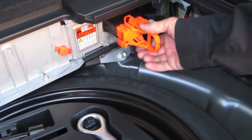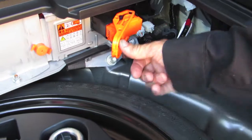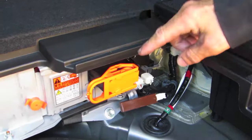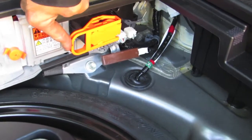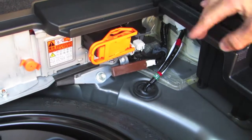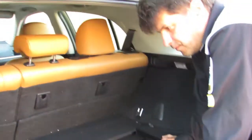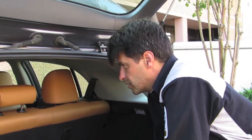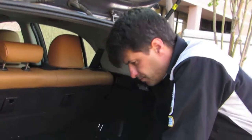Start to rotate it — you see it's going in. Some people make this mistake: they go all the way in and think it's done. No — even after you've pushed it all the way in, you still need to lock it. When you lock it, it's completely in. Now you're back to full power of the battery, and the battery will supply high voltage to the whole car.